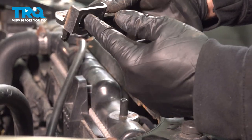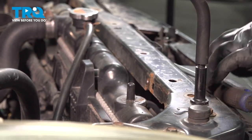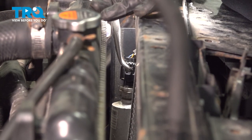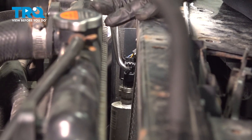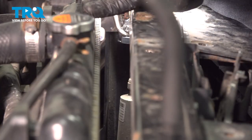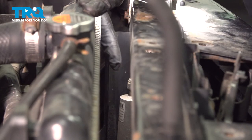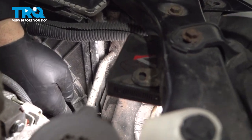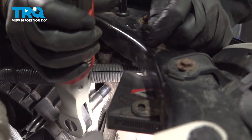I'm going to use a pair of pliers with a hook on there to go to the harness connector right here. I'm just going to gently pinch the little lock tab on the top, wiggle that gently, and pull up. Go ahead and pop that off. I'm going to go ahead and remove the pressure switch right on the top of the AC condenser. On the AC condenser, you have the upper line and then there's a lower line down below — they're held in place by 10-millimeter bolts. Let's go ahead and loosen and remove the bolts and separate the line from the condenser.